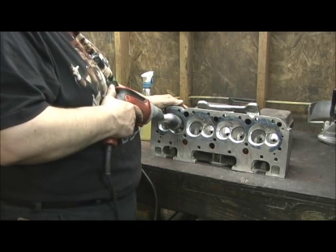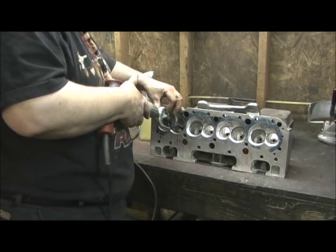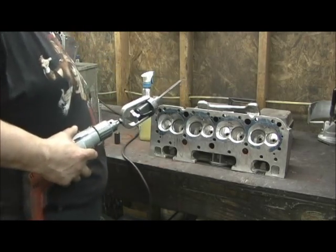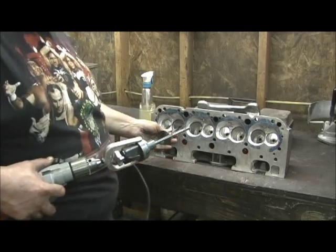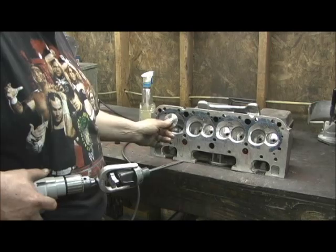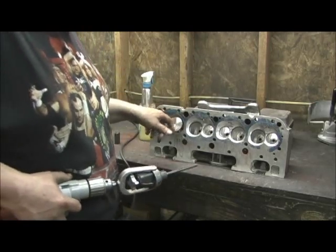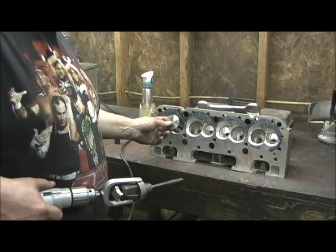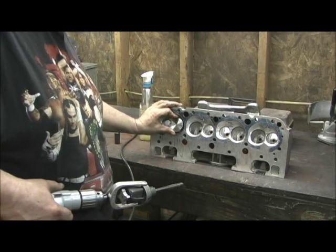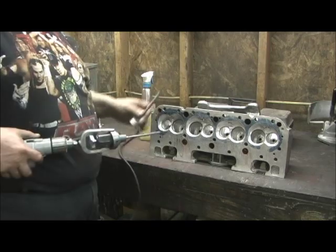I'll get a full stroke pass, come in here and then I stop and do a primary check. This is an intake valve. I make sure it passes through on this end. Now when I turn the heads around the other direction I'll go in there and use my measuring tools. It's just a little bit to the tight side now, not much — I can barely get any wiggle out of it. It's more of a feel thing.